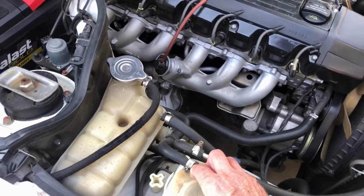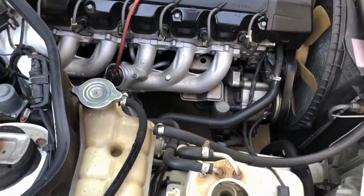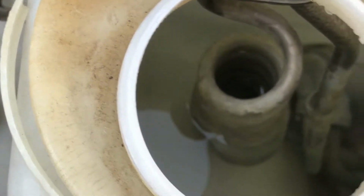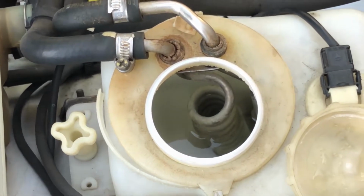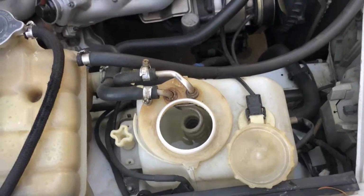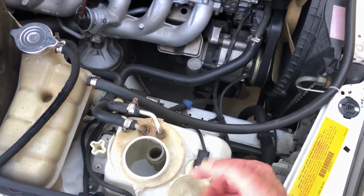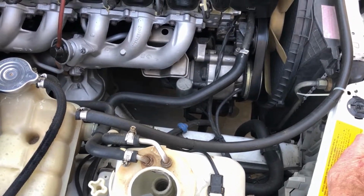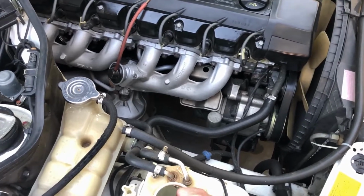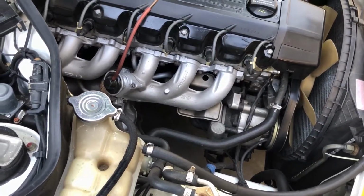the coil in these things, at least on my SL, I have a 91 SL, and it overheated and scared the crap out of me. But it's got this coil in here, and down at the very bottom of the coil is like a little thermostatic block with 2 holes, one for each of these lines. I guess in the winter, in really cold places where the water freezes, coolant runs through this coil and heats the water, keeps it from freezing, so you can scrape the snow off your headlights and windshield. But here in Southern California, you don't really need it.